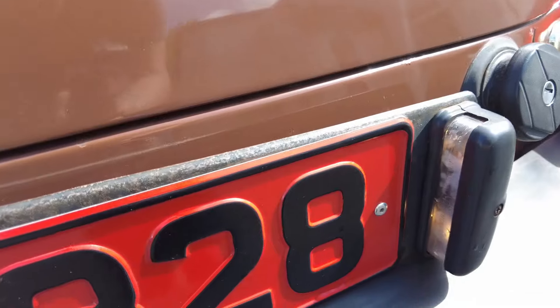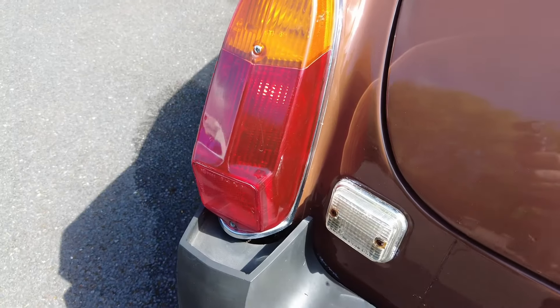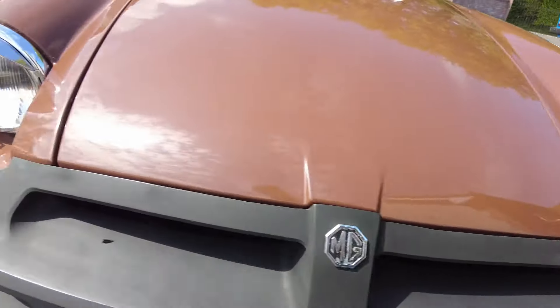You can see our taillights are working, number plate lights — they're all good. Same at the front. And don't forget folks, if you have an electric radiator fan, make sure you leave the engine long enough to warm up so that the fan comes on — you need to know it's going to function on the open road. That's been the downfall of many people getting their cars out and realising it's overheating when stuck in traffic.